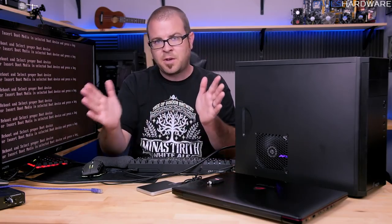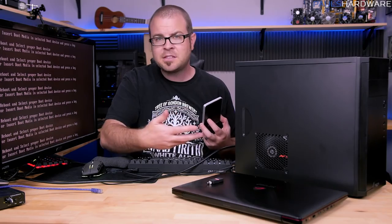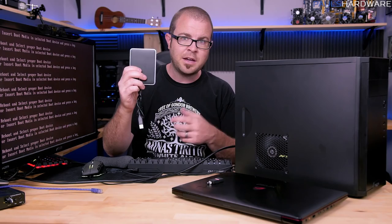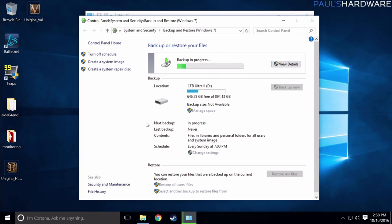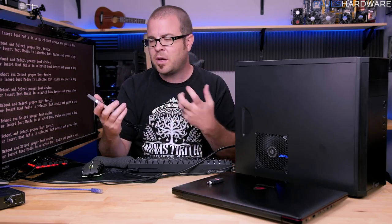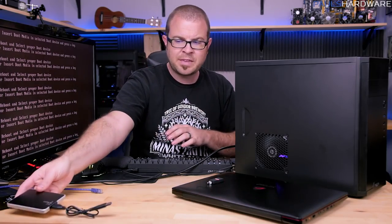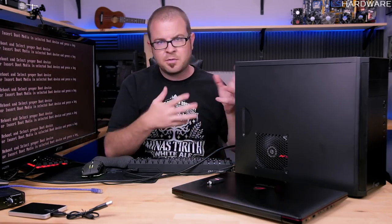Finally, and this is just a fair warning to any of you guys who are actually using this as a tutorial for upgrading a system or installing Windows on a system that might have data on there already: an external drive, something that you can plug into the system while it's working, copy everything onto it. Again, there's nothing to copy off of this one right now since it's brand new, but make sure that if you have any personal information, pictures, My Documents, anything that's irreplaceable that you can't re-download from the web, like basic program installers and stuff, get that onto an external drive, unplug it, set it aside, and that way you'll know that even if something terrible goes wrong, you will still have your data and you can rebuild everything the way it was before.